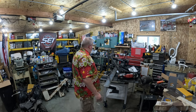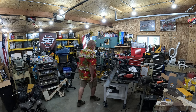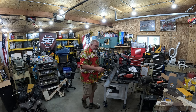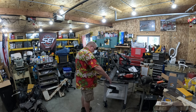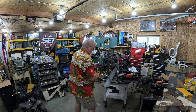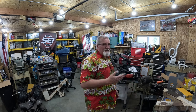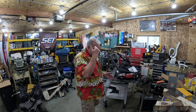Okay, now, as you can see here, there is another saw in the shop. I still got this saw back here that is on my chop off. I use it as a cutoff, and it's worked fantastic for doing some quick cutoffs. It'll cut through, as you saw in the video, this tubing. This is some 4.5 inch wide. Golly, is that 316 stock, I think? Get off the scale here. That's 1/4 inch. Zips right through that. But you gotta cut it the edge way, not the long way, because I don't have a coarse enough tooth on there to do it this direction, which is fine.